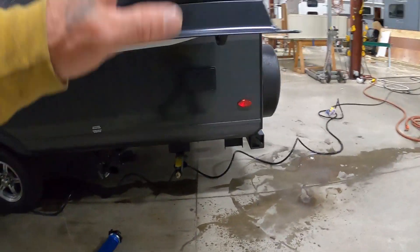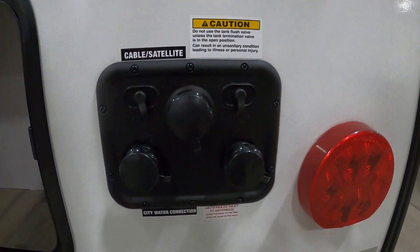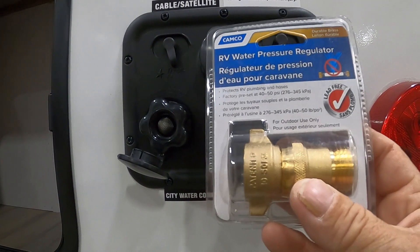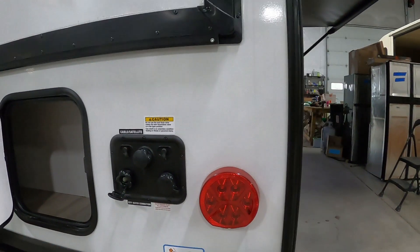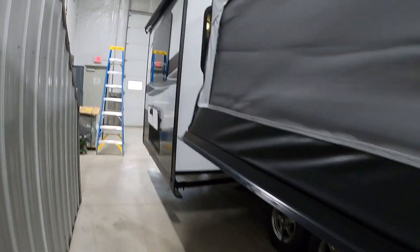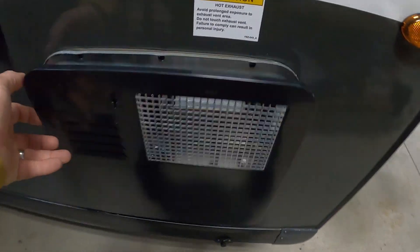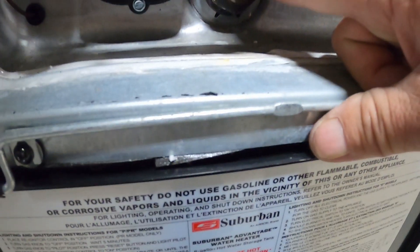Now let's hook up your water. At this point none of your beds would normally be down. At the docking station at campsites, we're going to hook up to the city water connection. First and foremost, use a water pressure regulator — this reduces water pressure to 40 to 50 PSI, protecting your lines and the unit. You don't know what the water pressure is at different campsites, so always use one. Hook that up, then hook up your hose. Don't turn your hose on yet. Find your hot water heater — make sure your drain plug is back in. Get a little plumber's tape around it, not putty, as putty will gum up. Get it in there nice and snug.